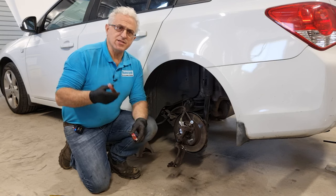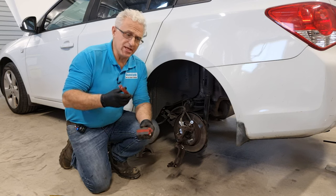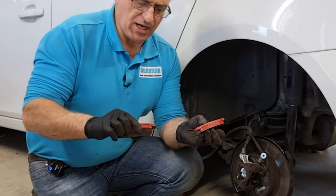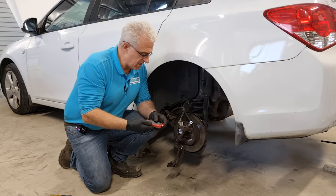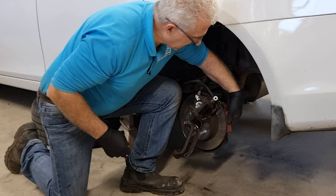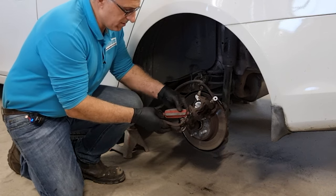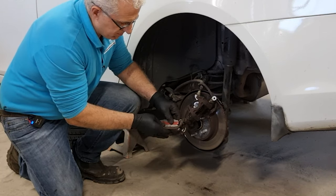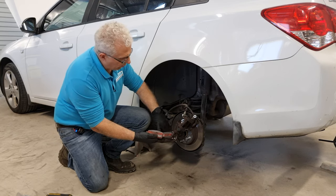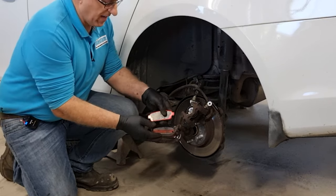Now it's time to put the pads in. These pads are not Bendix brand per se — in fact they're made by Calibre, which is a subsidiary of Bendix. I wasn't able to get the proper brand on the day. There's a mark on the back: an 'in' and an 'out'. The 'in' is really important to get right — it's where it sits on the piston side. Make sure you put it the right way up. The one that says 'out' goes on the outside. The two red stripes are what touch the disc, so make sure you put it the right way around. The black section on these pads sits on the outside, facing outwards.